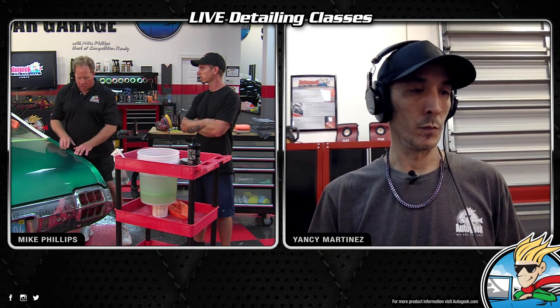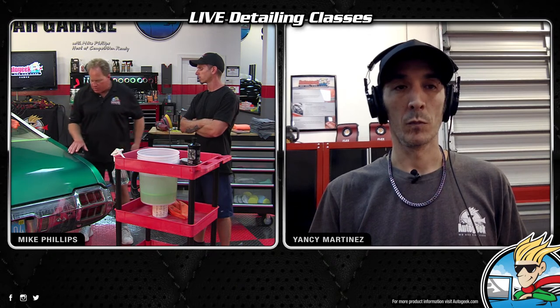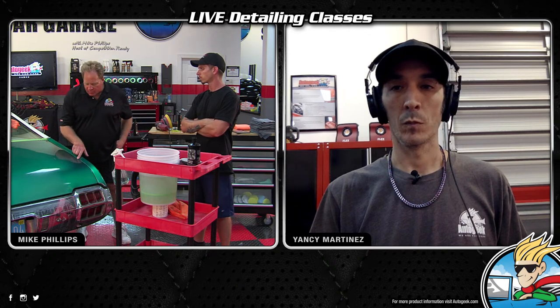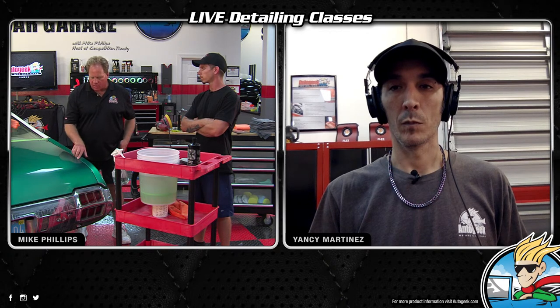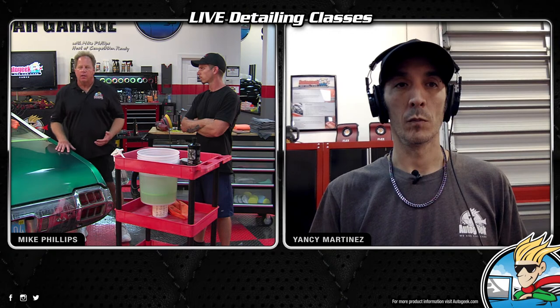And if I pop the trunk, then there's a technique called buffing off the edge, where your rotary pad spins off edge instead of grabbing. And we showed that in a recent video. But still, once you start buffing on this edge, the paint tends to be thinner there. It's a high point. More pressure is going to be created there. And if you're not careful, you're going to burn through. So, you know, it just depends.